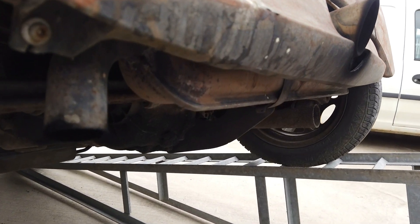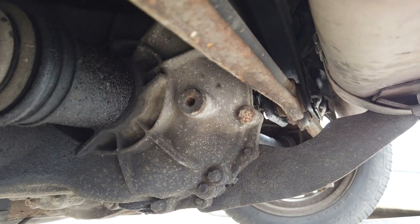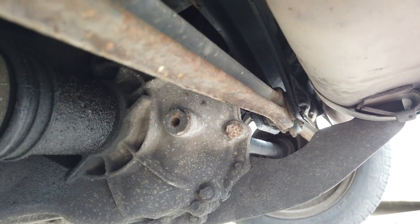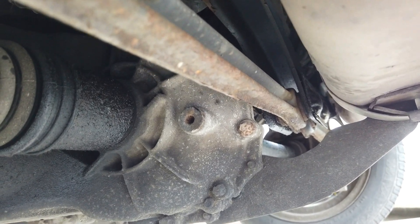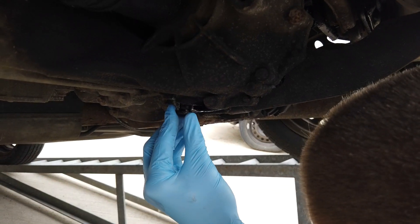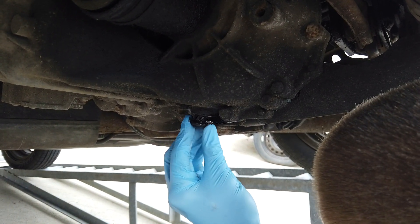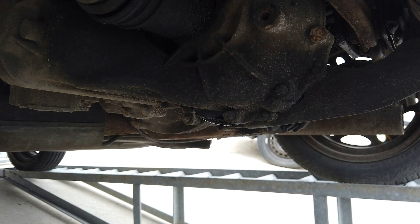So under our Smart car here, here's the filler hole — there in the middle of the picture. That's got an eight millimeter hex socket on it. Let's have a go at undoing that Tyler and see if we can fill it. The first thing to do before we do anything — otherwise it'll be a schoolboy error — is put the drain plug back in. Apparently you can put some sticky stuff around it to stop it falling out, but if you just put that in and do it up.